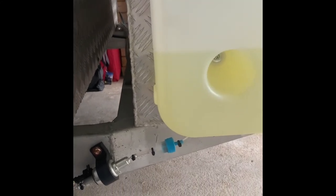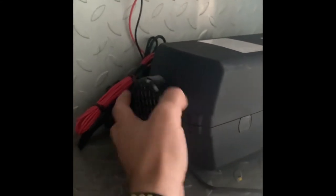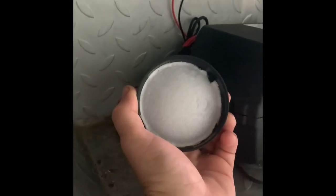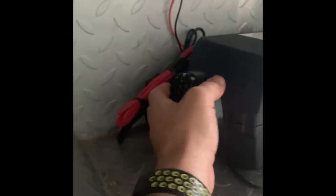We placed the diesel tank on the front toolbox. It comes with a lot of tek screws but I've changed a lot of it to just nuts and bolts, running down into a fuel filter, into the fuel pump, and then into the main diesel heater. To stop any dust I've cut a piece of foam that came with the packing and placed it in the front there.